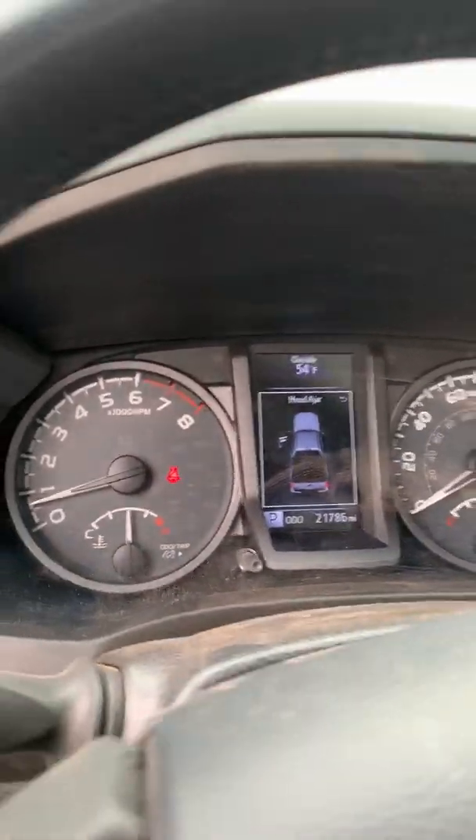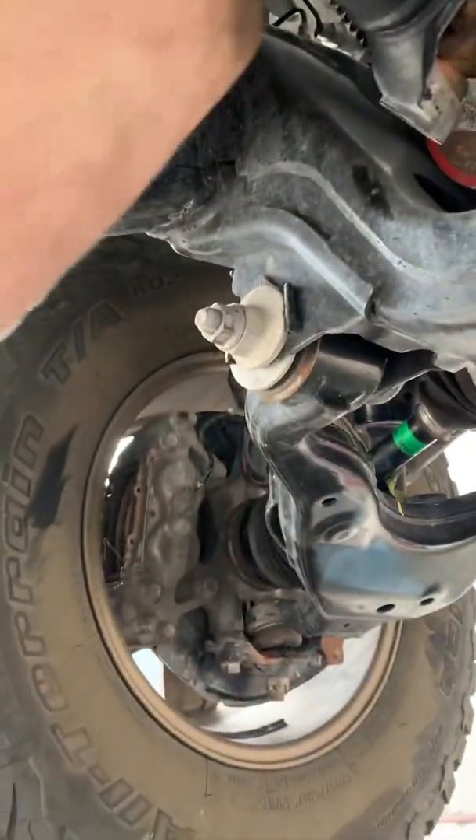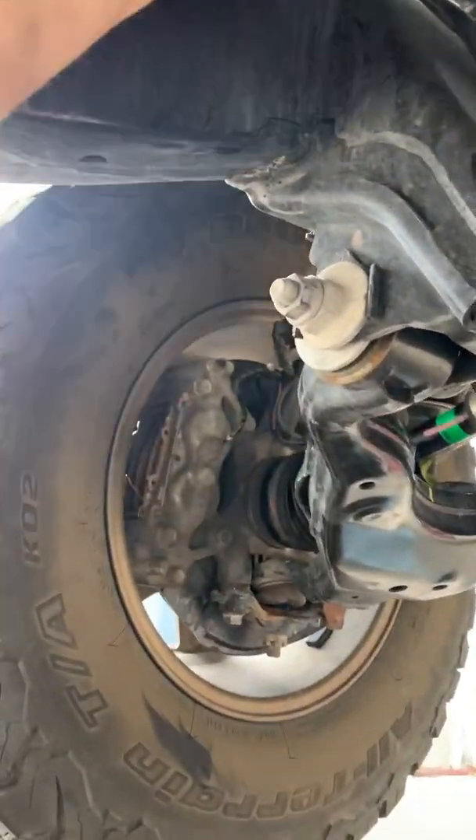To simulate that, we'll put the vehicle into two-wheel drive. Now we're going to come under here and simulate moving forward — we'll rotate the front driveline until that tire turns. As you can see, that one does not turn, so our ADD is disconnected but the e-locker is engaged.